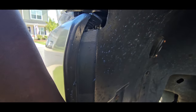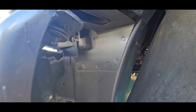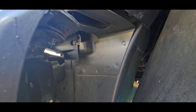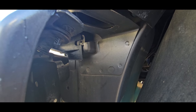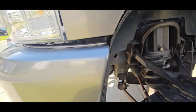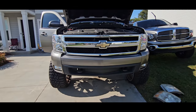If you pull this out — as you can see it's up in there, right there at the top. We haven't put the screw in yet but it's a screw that goes in there too. It should be an 8 or 10mm — it just depends on if somebody took your lights out before. But that's how you remove the actual headlight. These down here are the old lights.